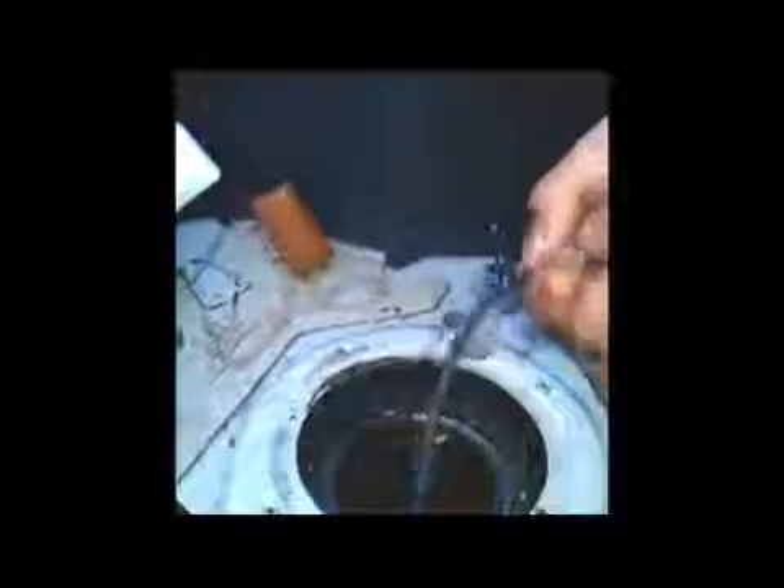Before we do this, I really want to show this. This is your fuel cover o-ring right here, and this is going to keep the smell of gas out of your car. Because a lot of times — like on our buddy's car — this is shot, so his car constantly smells like gas. They also sell these on njukuracing.com. I'm going to clean it off so I get a nice seal — I don't want my car smelling like gas. Clean off where it seats. You'll see it's a small silver ring right here — this is where it seats. Place that o-ring back on there, nice and even.